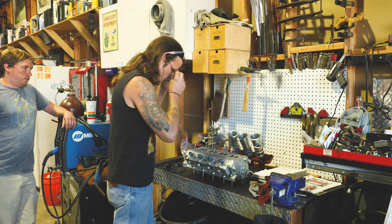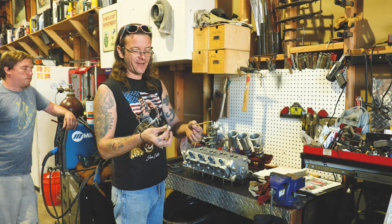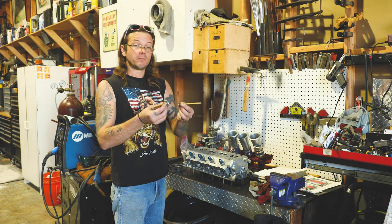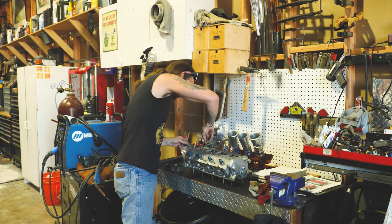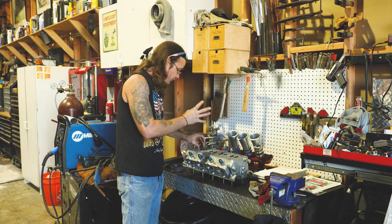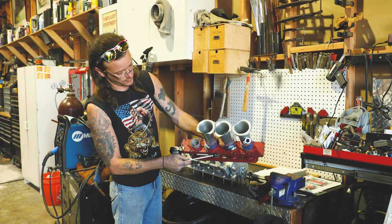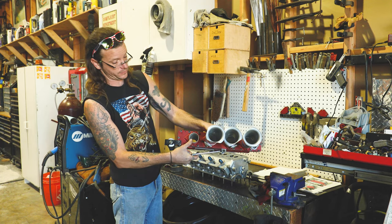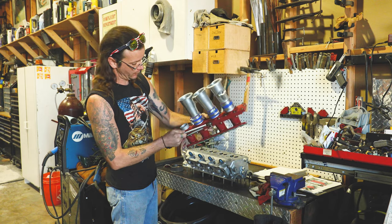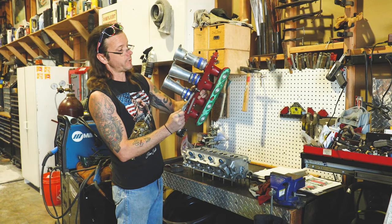This is the so-called four-valve engine — for obvious reasons it has four valves. These are titanium, titanium nitride coated, and they weigh almost nothing. That reduced mass means they open and close even faster than they normally would. To take advantage of the increased breathing four valves give you, we have a flat slide valve which at wide open throttle is a direct shot right to the engine — you can actually see the valves running if you've got the engine on the dyno.